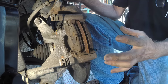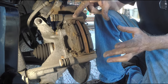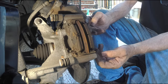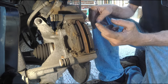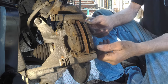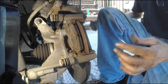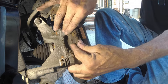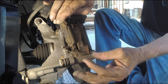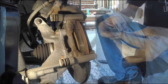As you can see here, these are the brakes — they're spread apart. Pay attention to those spring clips and retain the clips. You want to make sure you have some freedom and things come out easy. I'm pointing at the clips. Pay attention to which way the fronts are and the rears are. Pay attention to how things are and look at every single detail, because later on you're going to want to know that.